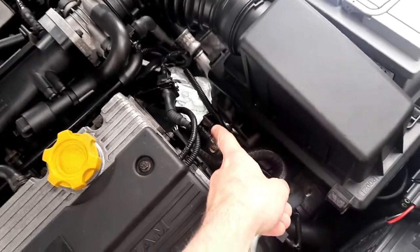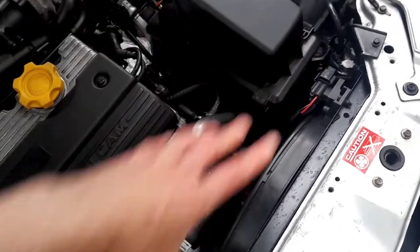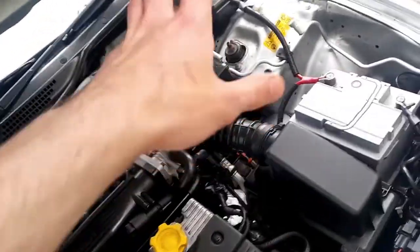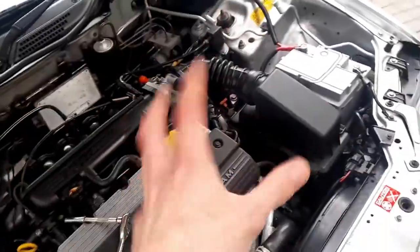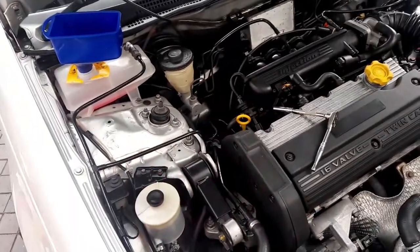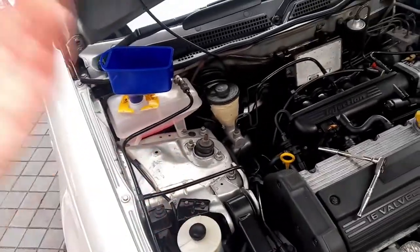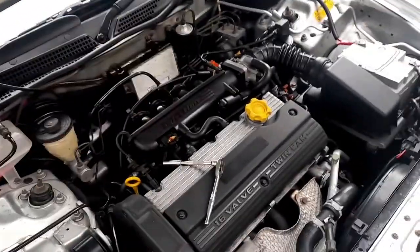And because the air went up, the coolant went down, and the coolant has filled the radiator and those hoses, that space where the vacuum was. So hence why it keeps going down, because you've basically replaced the air with the coolant. It's a bit mind-boggling when you actually understand how it works, but there's a lot of science behind it which I don't understand. But when it comes to cars, that's as simple as I can put it in plain English.